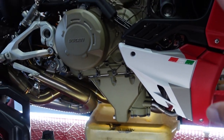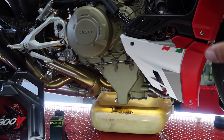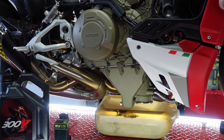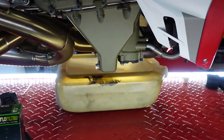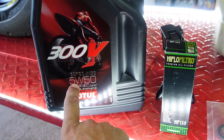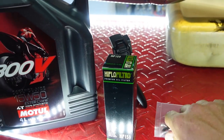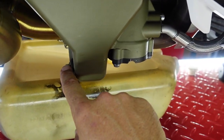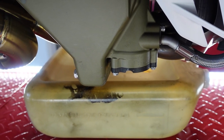The bike has been sitting and hasn't been run. I would encourage you guys not to let the bike run overnight before you do this — do it first thing in the morning, or let the bike sit for a couple of days. That means all the oil is in the pan and the filter. I choose the Motul 300V 15/50 and I use the high-flow filter. What's nice about their kits is they give you the two washers and the crush washer for your drain nut, and two washers for the filter housing.